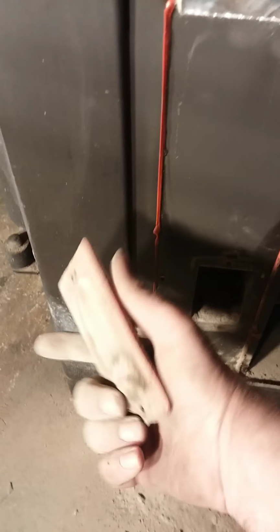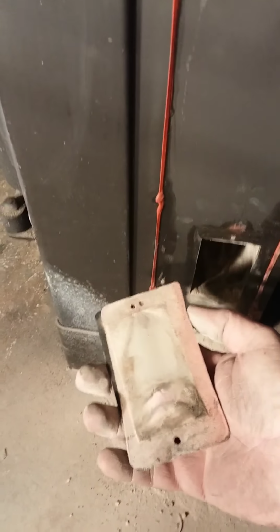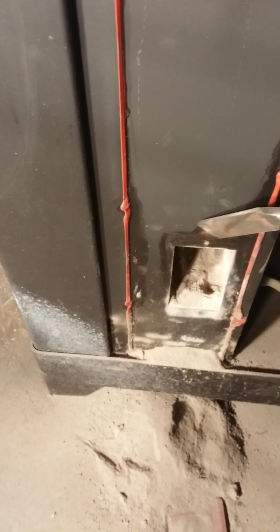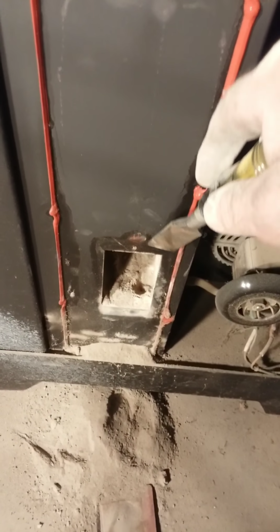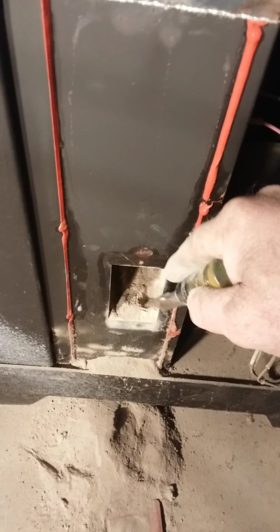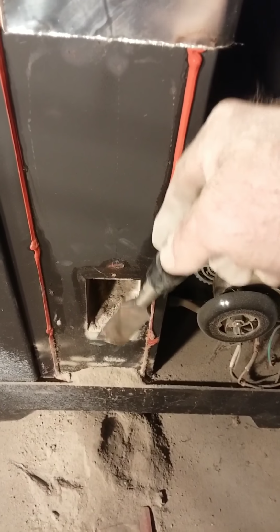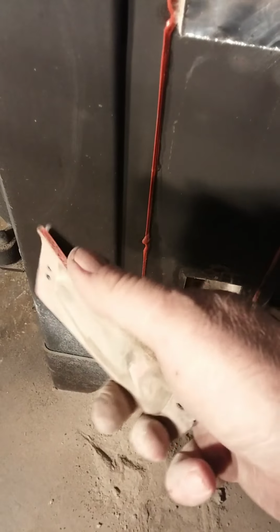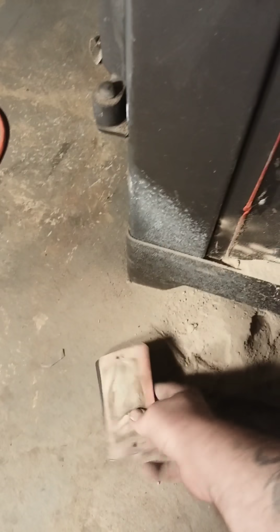When you do take this off, they didn't put this gasket on right, whoever put it on at the factory. But when you do take this off, make sure you don't rip the gasket. Be very gentle. What I did was, you could get a metal scraper, but all I had available to me right now was this chisel. I didn't want to go out into the garage. It's a sharp chisel, but I just gingerly went in the back of the gasket, pulled the plate and worked it, and it pops off because there's no adhesive. It's just like a fireproof vinyl, a rubber gasket of some sort. So obviously a fire resistant, temperature gasket. Comes off with 2 screws, goes right there on the side.